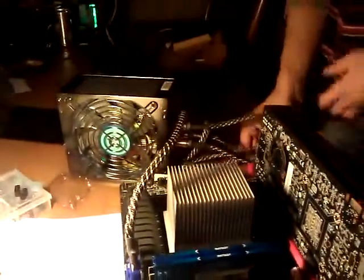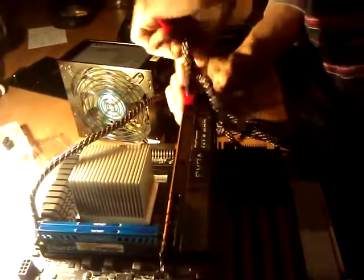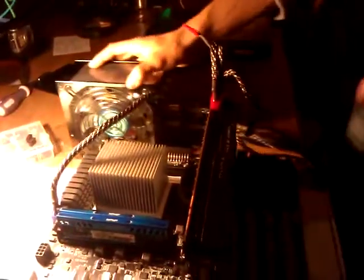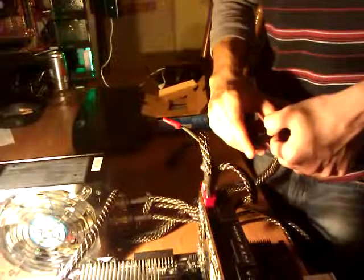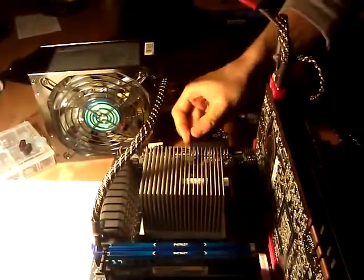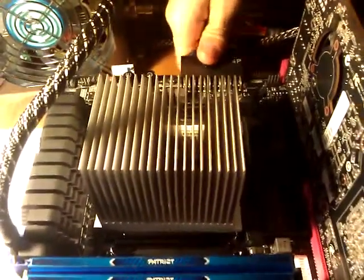This is the second 8-pin for overclocking — I'm only going to plug in one right now. Then I'm going to plug in power to the graphics card, just like so. By the way, this is an 800-watt Kingwin power supply. Everything is pretty sturdy on here. Last thing is plugging in the 24-pin. Hold it together real good. It's in there stable — good.